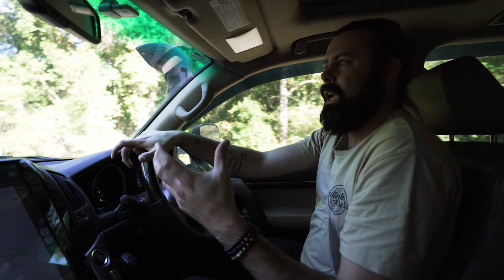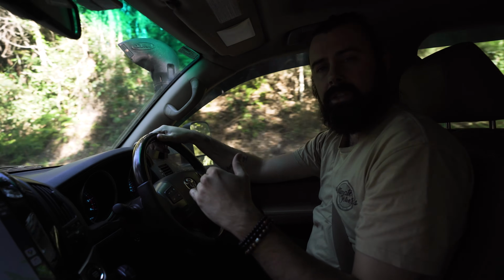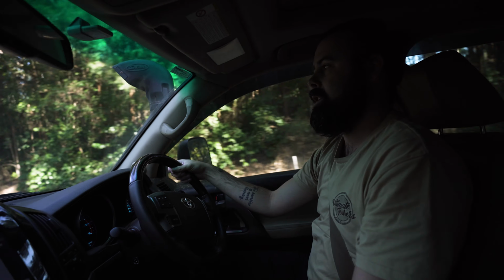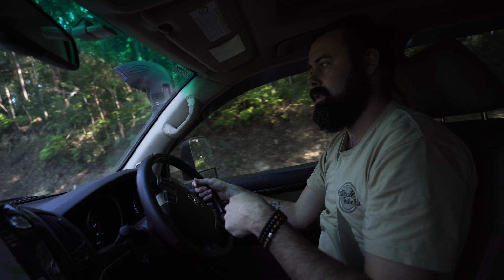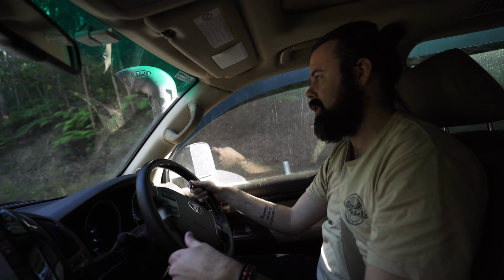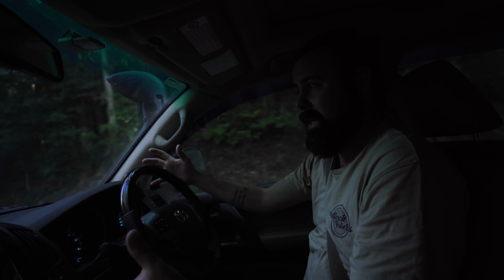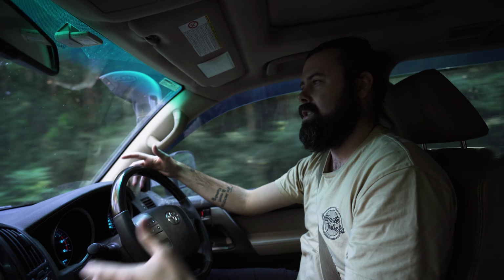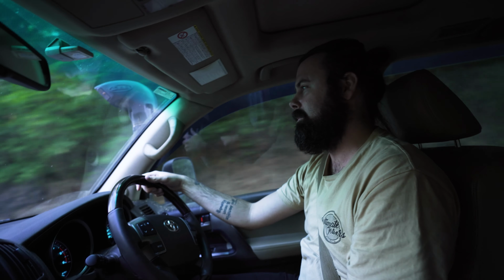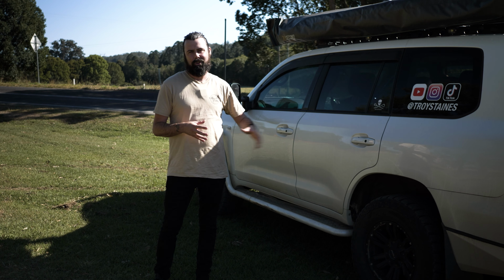The sand is putting increased load on your car. You'll feel your car shifting and hunting for gears constantly. The best thing you can do is pull the car into manual gear select third or fourth gear, throw this lockup kit into low speed function, and you'll find that the car will drive a lot better on the sand because you're getting more torque to your wheels and you're really reducing the stress on your drivetrain and reducing any heat.